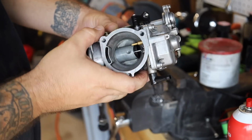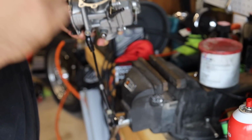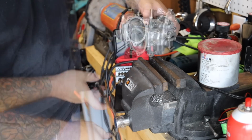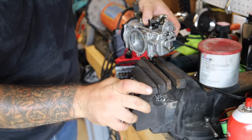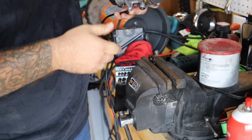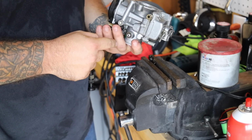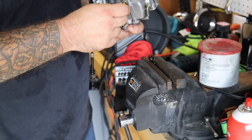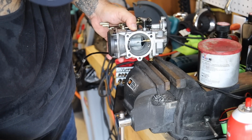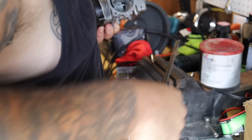One other thing that Shelby found, because he knows how to check for everything, is that this right here was leaking. And I've never pulled one out before, so I figured I'd turn on the camera for this. And this is a plastic one, so you said it's just gonna break when I pull on it. Okay. Oh, and that's the brass insert that comes out. Yep, and that screws out. No, that presses out. You have to grab that in place nice and tight. Oh, just literally do the same thing. Yeah. Okay, pry bar or a screwdriver or something, and pry on the carburetor up. Bam. Hey, look at that.